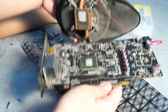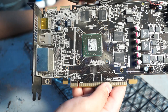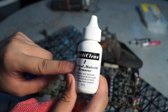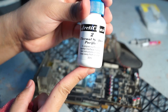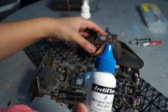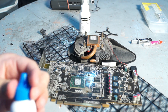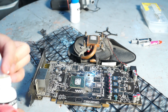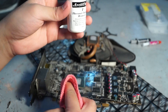Now let's see how crusty the inside of it is. Okay, so there's the GPU. We'll be replacing the gunk that's built up there. We'll be using the ArcticClean cleaning kit — this is a two-step process. We'll use the first solution to remove the thermal material that's dried up on the fan and the GPU. What I've seen on the net is they like to soak the thermal paste first, but I don't want to do that. So what I will do is dab the microfiber cloth with ArcticClean number one and then just wipe it off repeatedly.